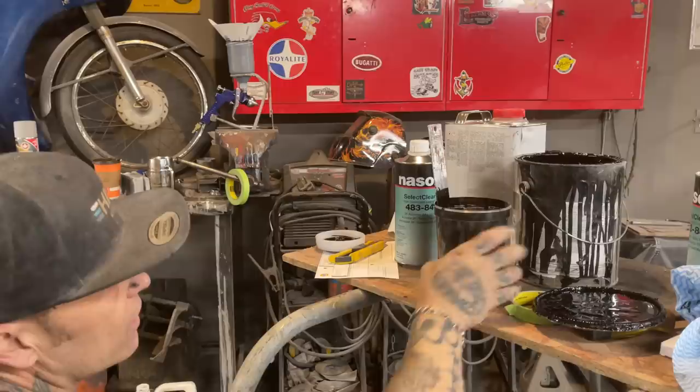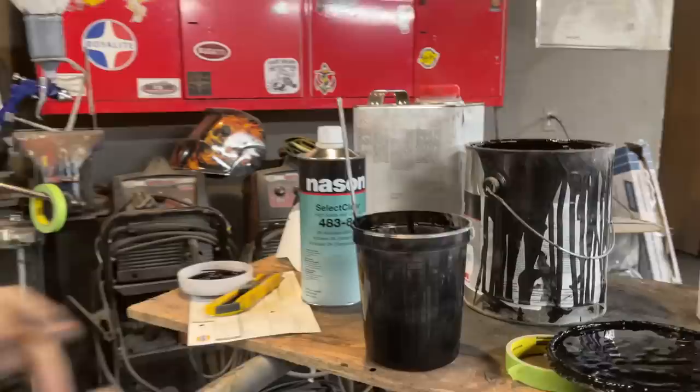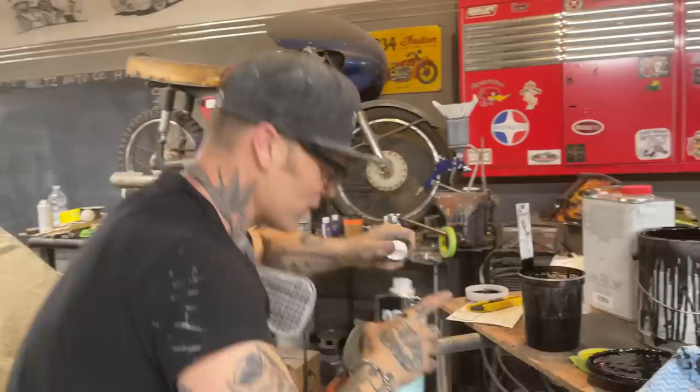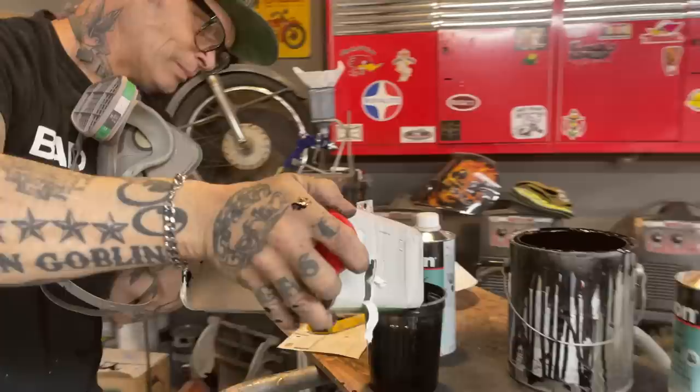Says 4-1-1 there, doesn't it? Huh, maybe? I'm in a mess. You see it? 4-1-1, there's 7 right there. I'll just mix it up and do it like I did last time. 7. Perfect. This here will make sure that I have enough paint. 7. Reducer goes to the top of the can. Probably mixing up more paint than I need.